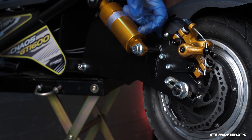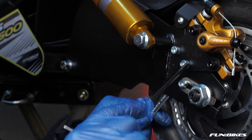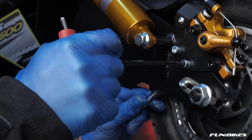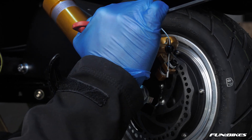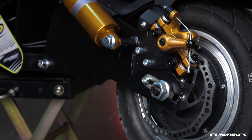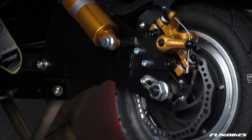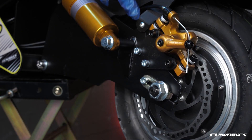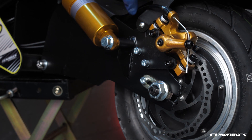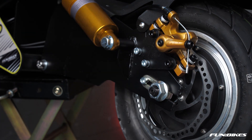You'll need a 10 spanner for the inside nut of the silver bolts. Using a 14 spanner make sure both the bottom mounting points are tight for your rear suspension, and then check your mounting points for your rear mud guard and the Phillips screws on top. Apply a small quantity of stud lock to the end of the threads on your rear axle.